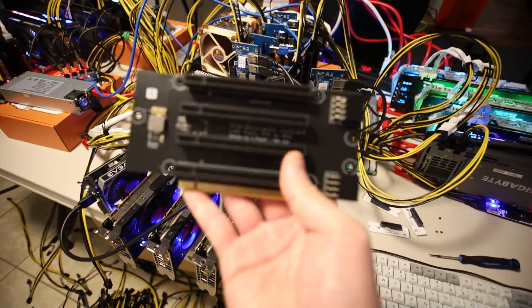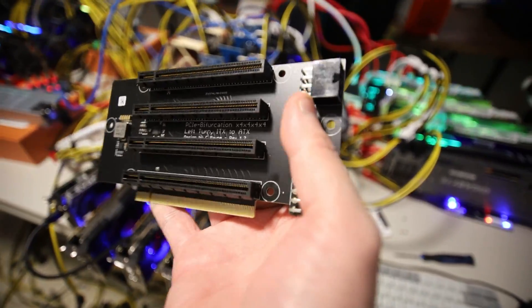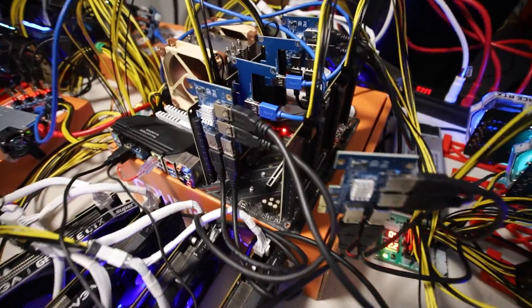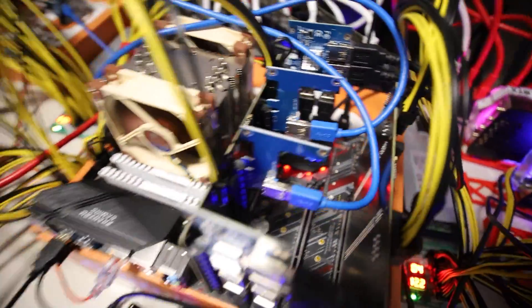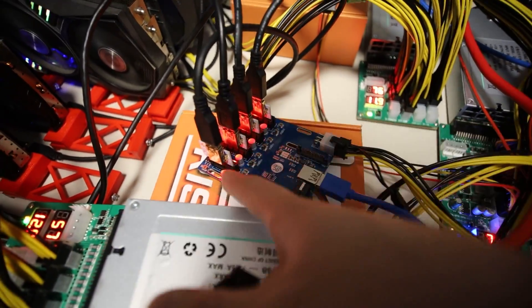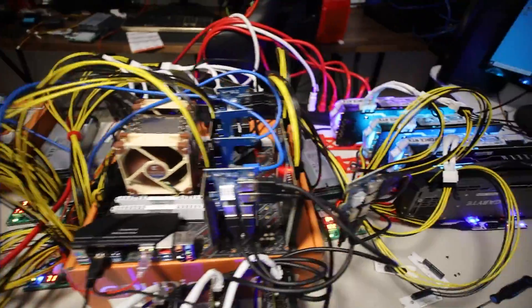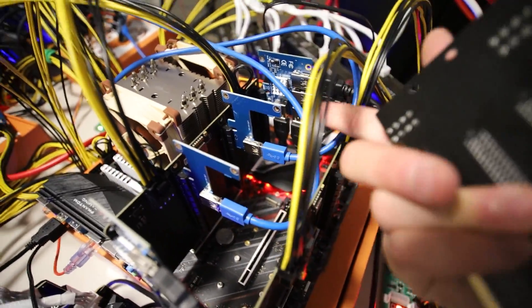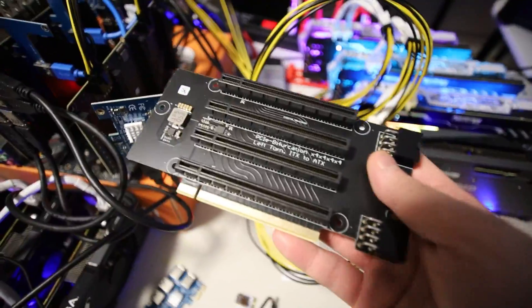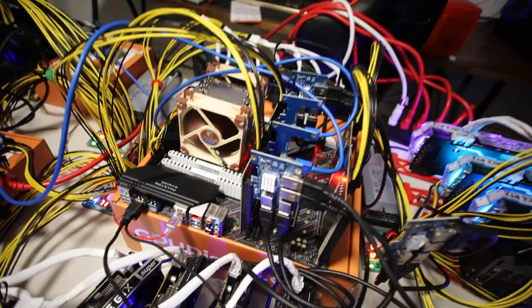Just to mention — I want to try these bifurcation cards on other motherboards. A disclaimer for anyone looking to buy these: you need to make sure your BIOS supports x4 x4 x4 x4 mode — if your motherboard doesn't support that, these probably won't work for getting 16 GPUs like I did with all these multiplier hubs and adapter cards from Triple A Wave. One thing to explain: all these x1 adapters from the risers natively drop down to x1 anyway, then the USB cable brings it to an x4 on the bifurcation card — so in theory that's why it works with 16 GPUs.